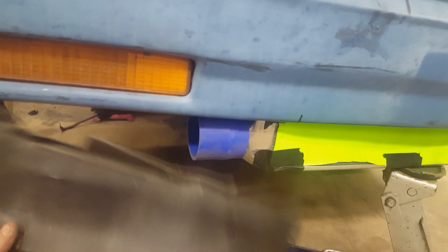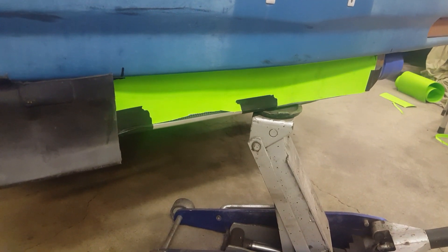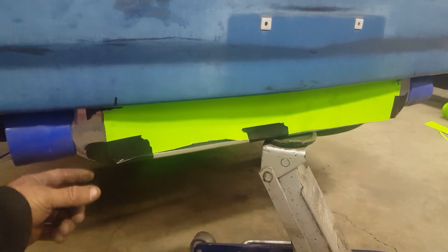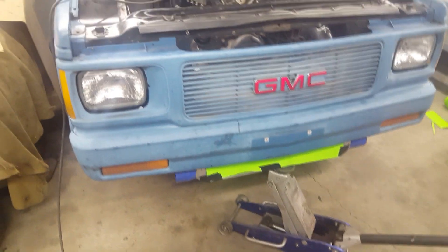You can see how much of the intercooler hangs below the bumper. Basically the stock spoiler covers quite a bit, but my plan is to have it open where the intercooler is — kind of go like this with a little bend and a lip on the very bottom to keep it stiff so it gets lots of cold air. I cut the bumper out so it's open underneath, so air will be able to go in there. I'll pull it all apart and take the grill and bumper off to start making the intercooler mount.